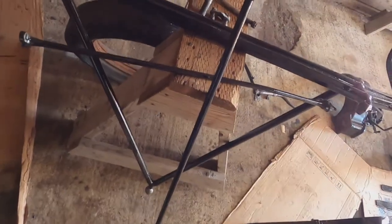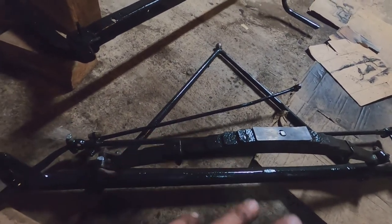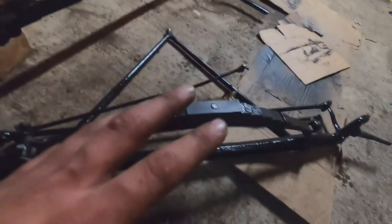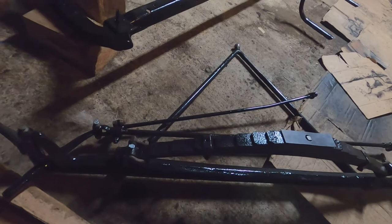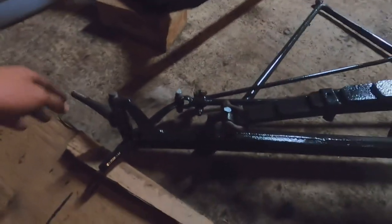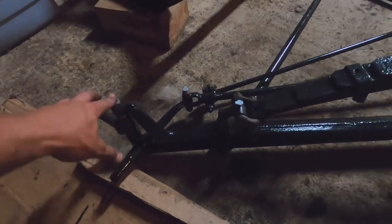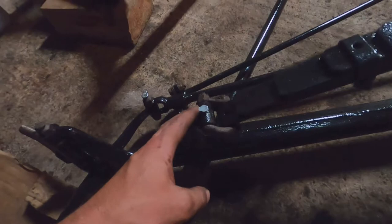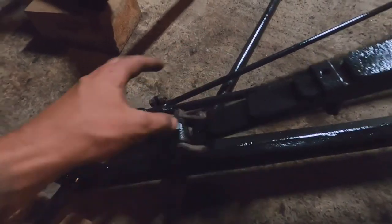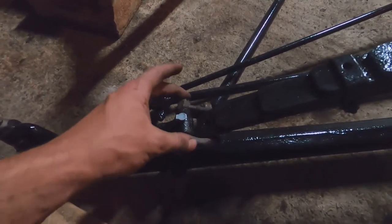So let's put this together. I've attached all of the painted components — I have the main leaf spring and then the steering components and the spindles on either side. Now I'm going to put in the few new parts. The oiler on the spindle bolt is the only original one still good — I had to get new oilers for everything else, and they're all over this front axle. Here's one installed on the hanger, which hangs the shackle on the leaf spring. You have an oiler on the hanger and one on the leaf spring, both of which oil the shackle.